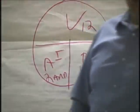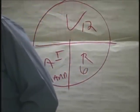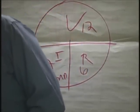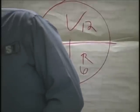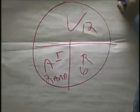Good. And this is something you have to be aware of. If this was a computer circuit, something pulling 2 amps, what's going to happen? The computer's going to burn, isn't it? That circuit is going to burn. Too much current flow. What is the magic number of what computers like? The maximum. 1.2. Good. Someone remembered from last time. So a max of about 1.2 for 6 milliseconds. That's the maximum amperage. Anything else is going to burn out.